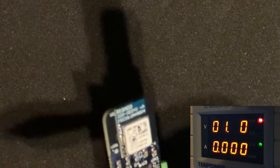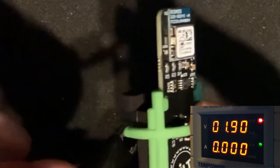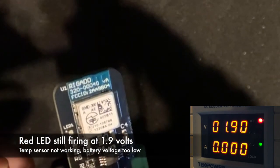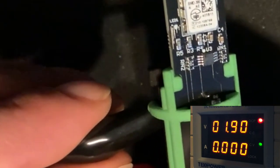I'm going to drop the voltage again to 1.9 volts. We're now at 1.9 volts. I will put in the equivalent of a 1.9-volt battery, which is very low. I just saw that LED fire — it's very faint. And now the temperature sensor stopped working; it's currently showing 32 degrees Fahrenheit, which is zero Celsius — essentially a zero value. The specific gravity is still working. I think if I go any lower the Bluetooth chip itself will stop working, so I'm going to cut it off here. This battery is very much dead. Thanks for watching.